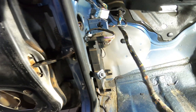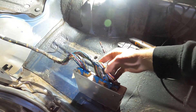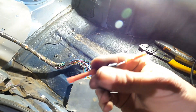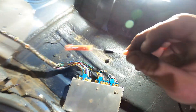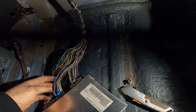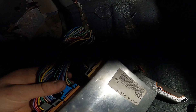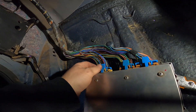Since I've stripped this car out, this is the room here for the ECU. I'm just going to cut back the tape on these wires here. I've pre-crimped a couple of crimps on this diode. You need to make sure you take note of the side that has the silver band. The connectors you're going to need are this small brown one here and this tan one — to release these you can pull them out, just grab these tabs here and pull.